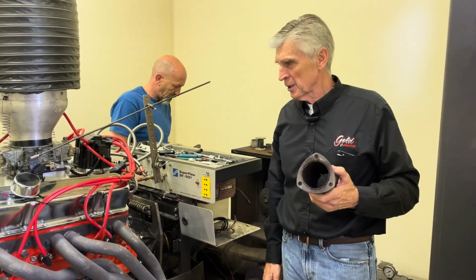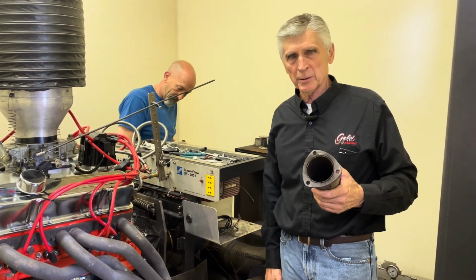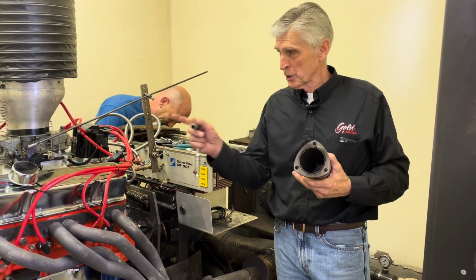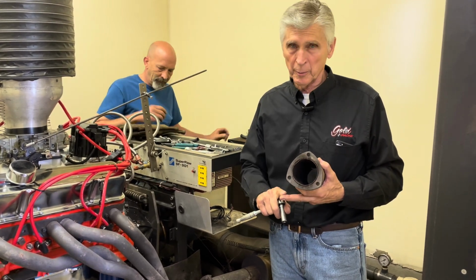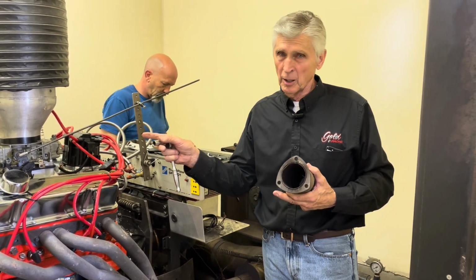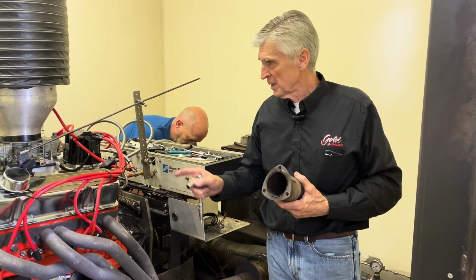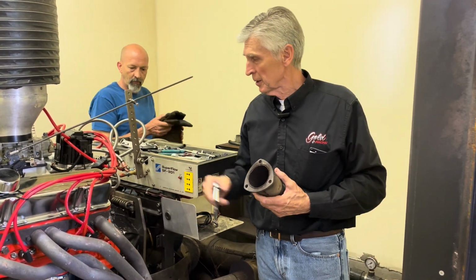Okay, we're here to learn, and so far, as I mentioned, we have a whole recorded trail of changes in timing, fuel, jets in the carburetor, etc. We've only used the one 4-barrel carburetor so far. We are going to make a run yet on the 2-barrel carburetor. But it's pulling right now almost exactly 500 CFM, so that's probably about the right size. And the 2-barrel is exactly 500 CFM, so let's see what that does.